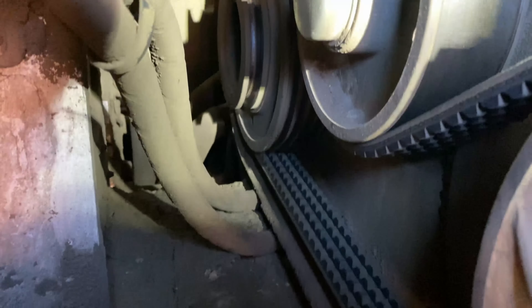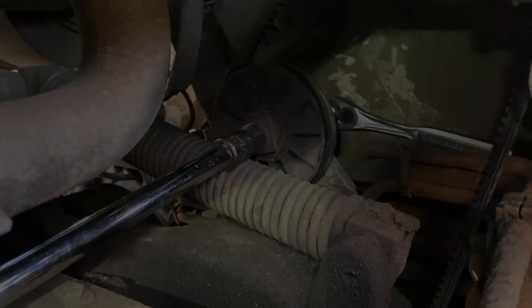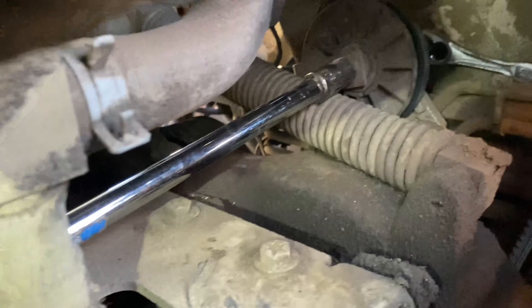We're looking at the machine from the door side. If you look real carefully — let's see if I can get this camera in here — there's the bottom pulley that I've got to go around way in the back there, and then I've got to get it to go around that tensioner pulley right there. There's the tensioner pulley, and there's a keeper on that tensioner pulley that I've got to tuck the belt under. Then it goes around that third pulley up top that we looked at already. I had to loosen the bolt on that tensioner pulley to be able to get the belt under the keeper — it was a little tricky, but I figured it out. Stick around, I'll show you how.